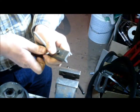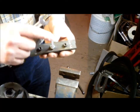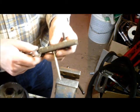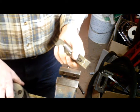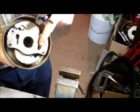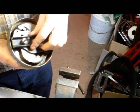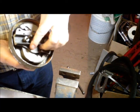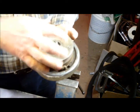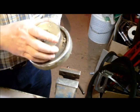We've got a nice long piece of rod here and a couple of socket head screws in here. The spacing of this coincides with the spacing on the clutch carrier. When it goes together, those two pins will locate the carrier. And that's very important, because when you're trying to take all of this off, it takes a heck of a lot of effort.